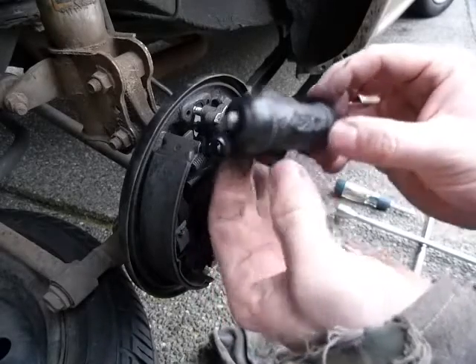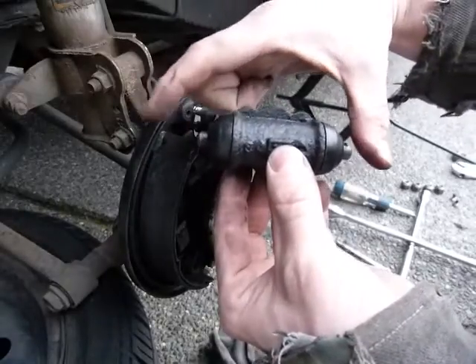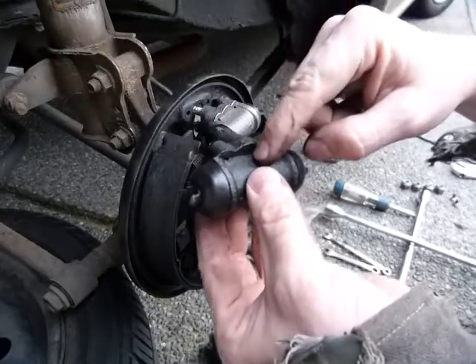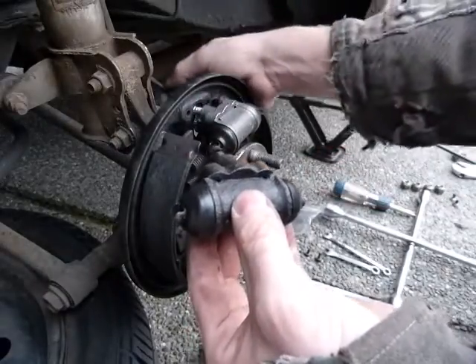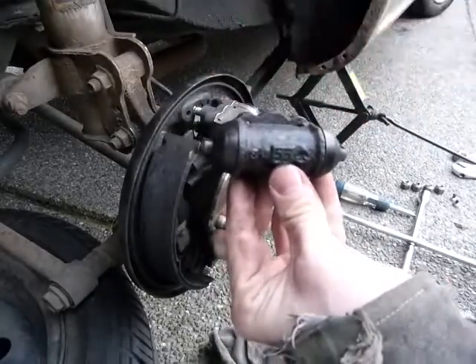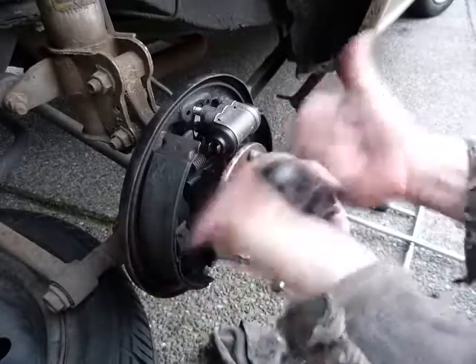This mounts — this is the wheel cylinder. It's a hydraulic cylinder. It's got two hydraulic pistons that extend from this cylinder when you apply brake pedal pressure. The brake fluid through these lines comes here and fills this. And then the pistons on both ends extend and pry apart the brake shoes, prying them against the brake drum. That's how you slow down.